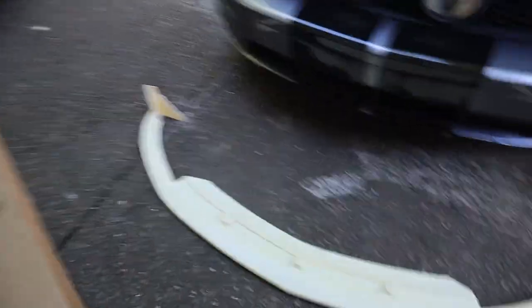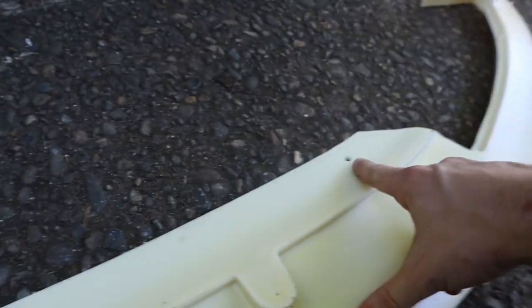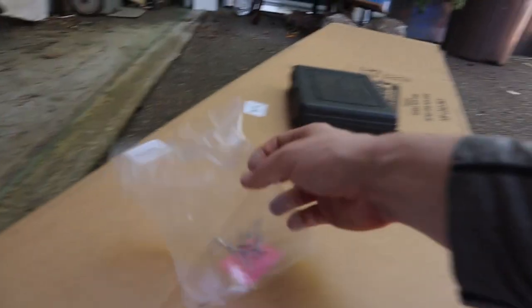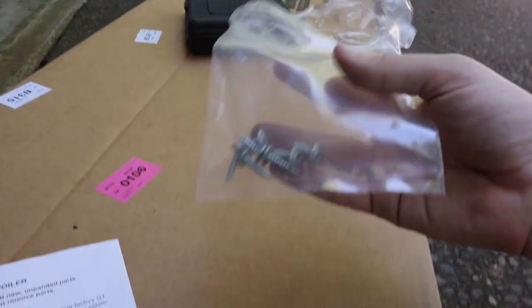So I just spent a little bit of time reading the directions. There are four holes on the underside of the splitter that use the factory hardware — those go up underneath the bumper with the stock screws. Then there are small pilot holes, three in the middle and two on both sides, that use the provided hardware. There are seven included screws. I'm going to put in the pre-drilled ones first, then do the three that need to drill into the bumper last.